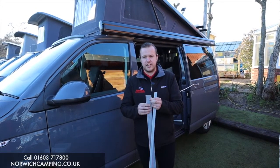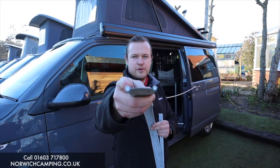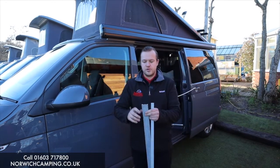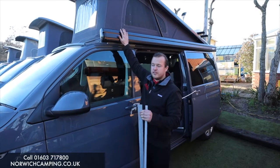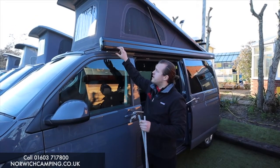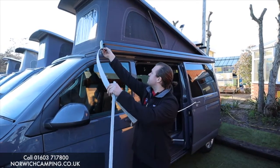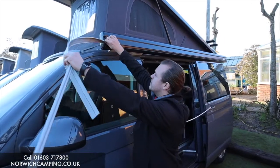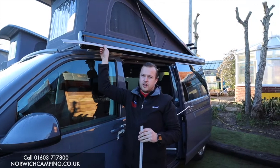There are two types of beading: a 4mm and a 6mm, so you have a 4mm this side and 6mm this side. Sometimes you have 6mm and 6mm — it depends what you're connecting it to. Here we have a Fiamma blind, and in these blinds and most other brands of blinds, there's a 4mm groove, so we put the 4mm side into there.